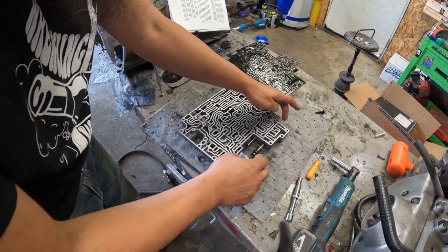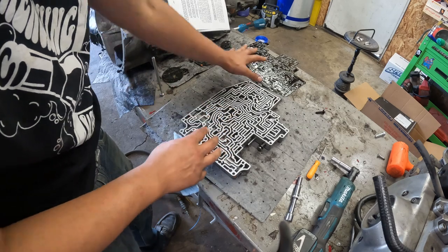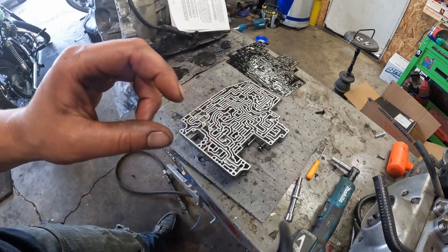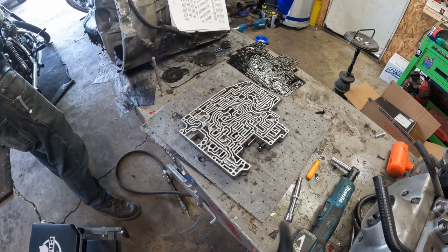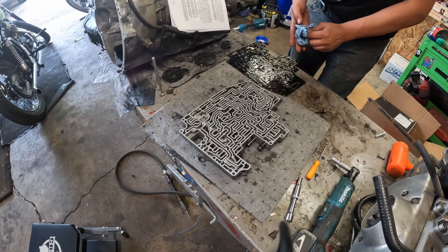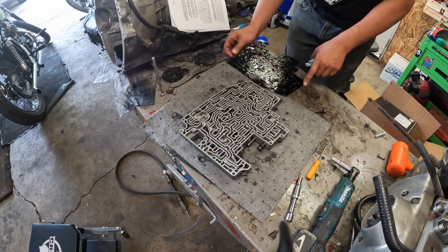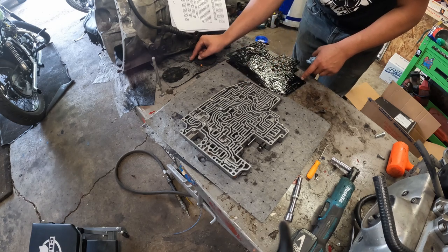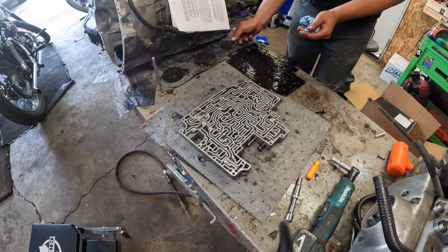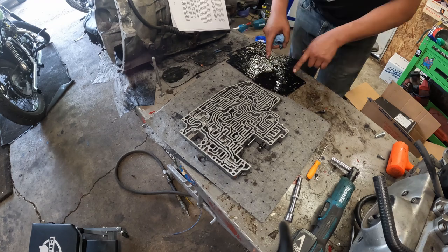This is drained for a little bit. The only other thing I want to do right now is remove the shifter. I think what I'm going to do is actually bring this and the plate back to the shop, start pulling the gasket off and put this in the parts washer because everything's covered in trans fluid. I know I'm gonna have to lay out the new gasket and drill a couple holes in here — there's like a cutback eliminator with a little plug that goes in somewhere in here. Oh, one more check ball — whoa, that was almost bad. Now I got seven check balls.